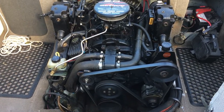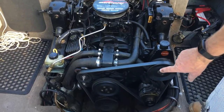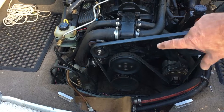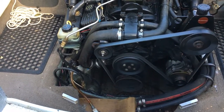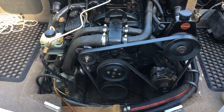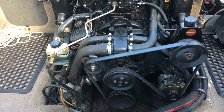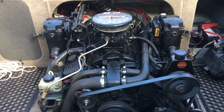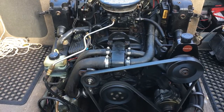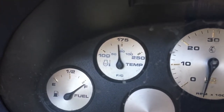It's a bit chuggy at the moment – they do have an auto choke. It's also a bit suspect on this water pump; it feels a little bit loose. The pulley there, you can feel it in the shaft. I can hear a slight bearing noise, so I might just replace it anyway. Let it run a bit – it's sitting up at a good temperature now.